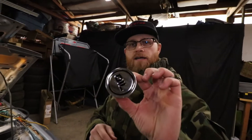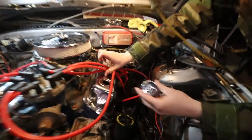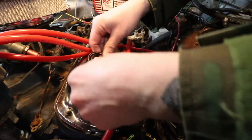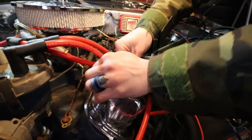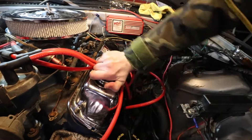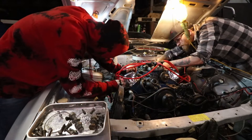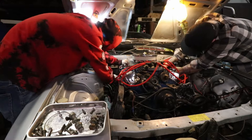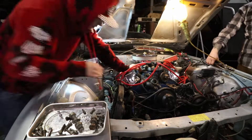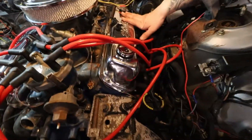We got this little oil cap undone - it's just got a little rubber back end here. This is the moment of truth - cross your fingers, hopefully it fits in this little hole. And it does! But it's a bit tough to get off. It'll be good for now. We got these valve covers on nice and tight. We went around evenly - kind of like how you put on a tire - getting a little tighter and tighter each time around.